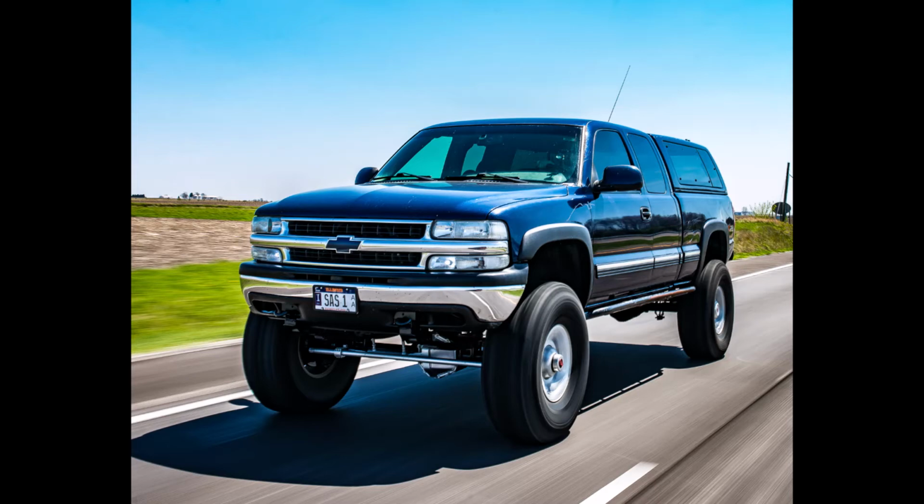So back to the full sizes are big. They don't call it full size for nothing. Both Mike and I have shortened wheelbases on ours. So Mike went real short, 123 inch from 143 or something. Mine was 148 with the front axle moved forward and the rear axle moved back a little bit. And so now I'm at 133, which is a lot better. Yeah. It makes a huge difference.